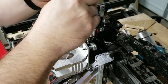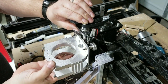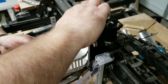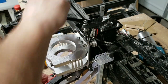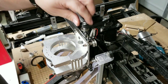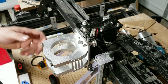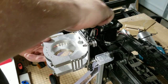We'll go ahead and get this positioned, lift it up, and get it into place. The 10mm lock nut goes back on. You can hold the vise grips and tighten this down — just snug, doesn't have to be super tight. At this point you can take the vise grips off if you want to. You just want to make sure that everything still turns freely.